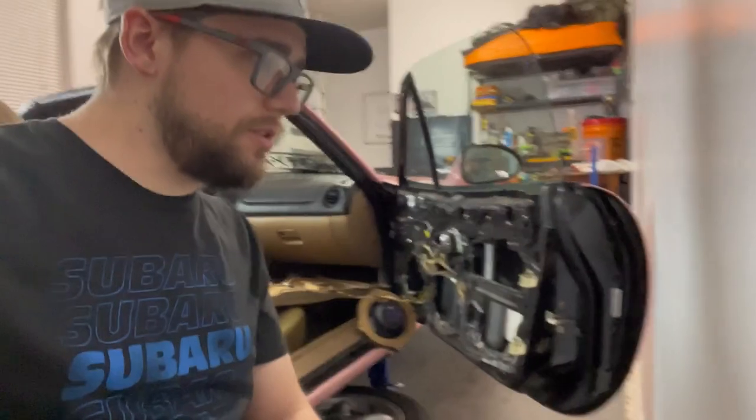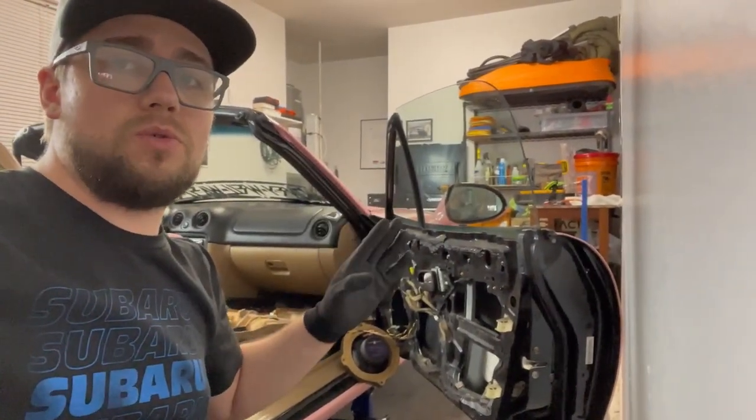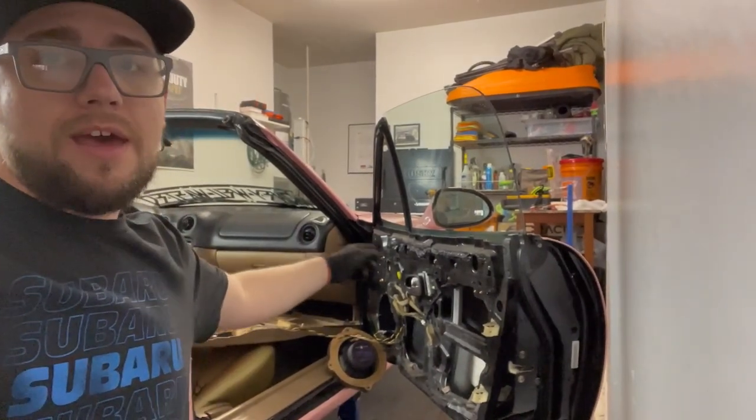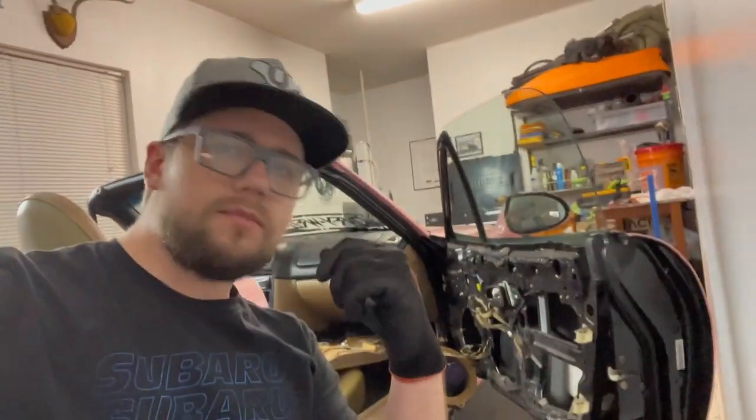Now I completely dug up the door and I pulled it entirely open. I checked the amp — where the power goes to the amp and then splits to the two speakers, the big door speaker and the tweeter — and the amp isn't receiving power. I went online and double-checked that the wires going into the amp are the correct color code for speaker power, and they are.